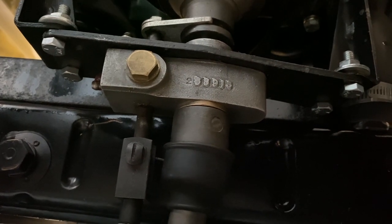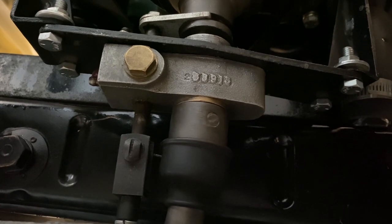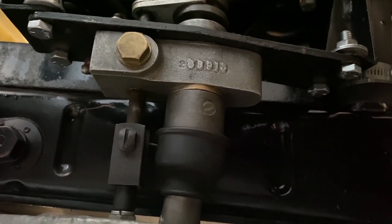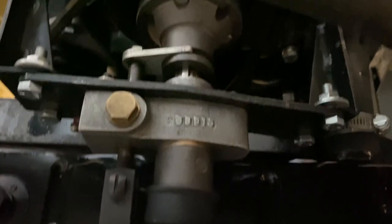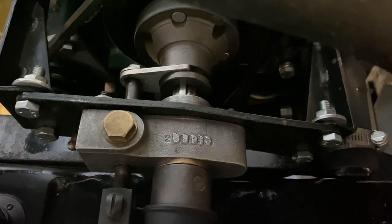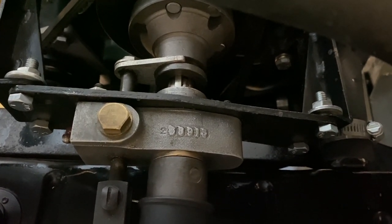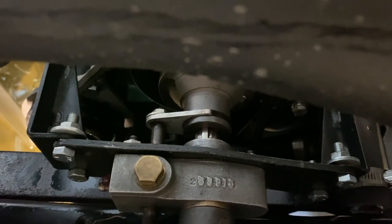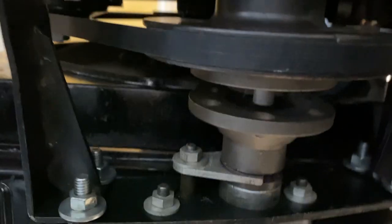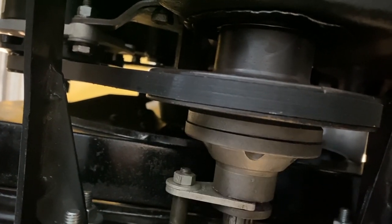And what you're looking at now is the support for the drive shaft with a bearing in it, and we can see the drive shaft turning. We can see the pins for the linkage, and there is that collar then, which slides back and forth. There's a radial groove cut in it with a bracket there, so that can move back and forth. And we can see it act on the front of the crankshaft there.